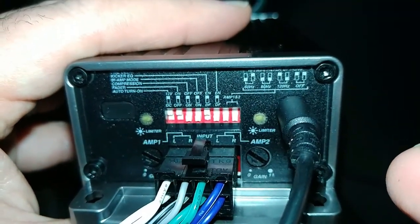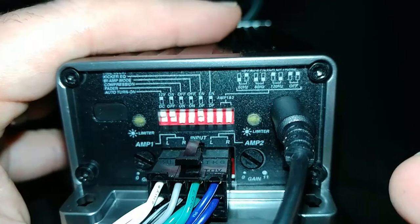Kind of see that little nub pointing towards zero. So got that one. Close all car windows. Got that. The bi-amp switch should be off. Make sure the microphone faces up, pointing as straight as possible to the roof.